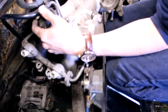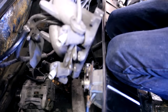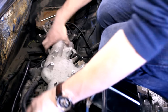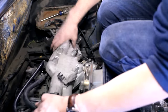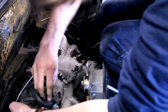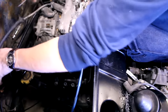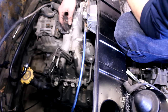There's the manifold. Looks like these fuel lines might be attached to the bottom. Since these fuel lines are attached to the intake manifold, I'm just going to take the rubber fuel lines off — just take these hose clamps off and slip them off. There we go — just lost a little bit of fuel. Luckily the fuel pump hasn't been hooked up for a while, so there wasn't too much fuel left in those lines.